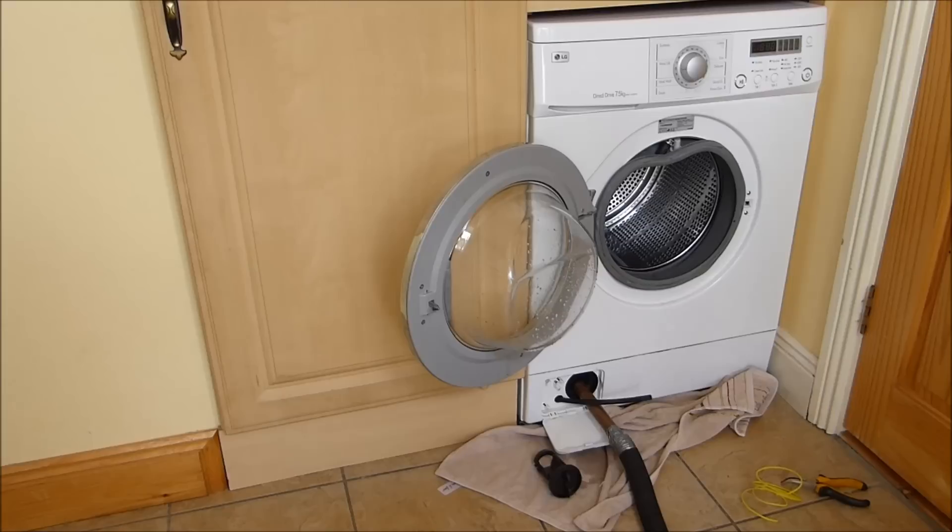The AquaVac will obviously suck water. As the filter is there, that tube that goes up to feed the jet can get blocked. So if I put the vacuum cleaner in there, pulling out whatever fluff, fibres, whatever mess is in there that's being mixed with water, I can use the vacuum cleaner for cleaning that out. If you don't have one, you can just put a kitchen brush or something in there and give it a good cleaning out. What I don't want to do is have to pull the pump out because then the front of this machine has to come off. So I'm just going to give that a quick go of the vacuum cleaner, and I'm going to show you how I clean the hose as well using it. Very easy.